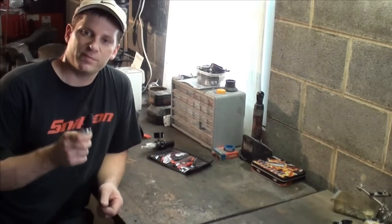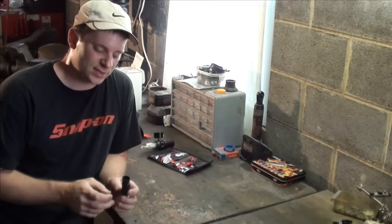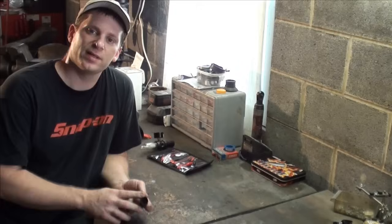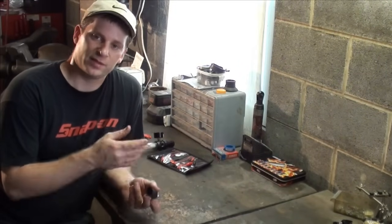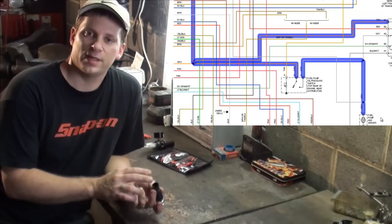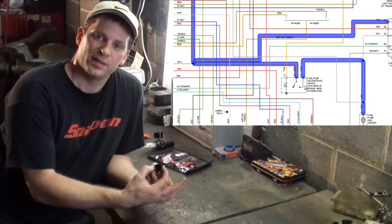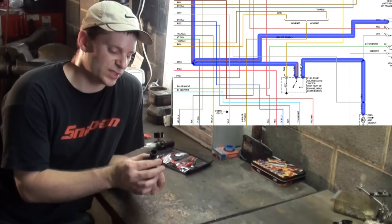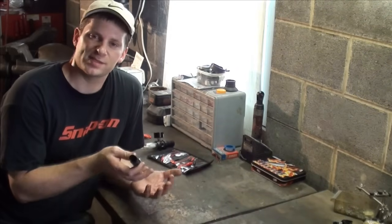Okay guys, I just got back from the parts store. I got the new pressure switch. Now I'm going to show you how to do a simple bench test so I can show you how it operates, and I'll be making sure the switch works correctly before I install it onto the vehicle. After looking at the wire diagram and inspecting the wiring on the vehicle, I determined it's the two outer terminals that are connected to the contacts on the inside of the switch that are going to close somewhere between 3 to 7 psi, give or take.